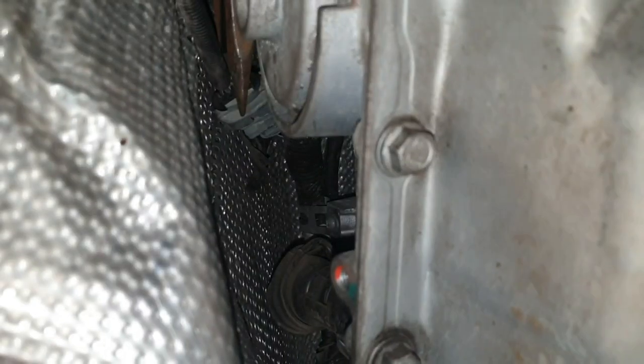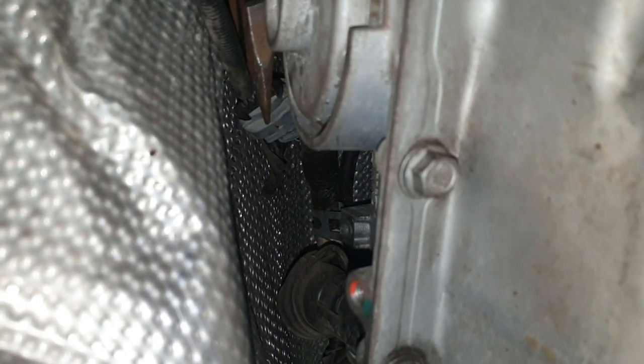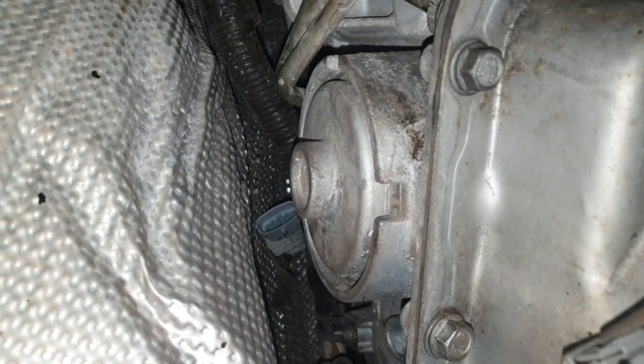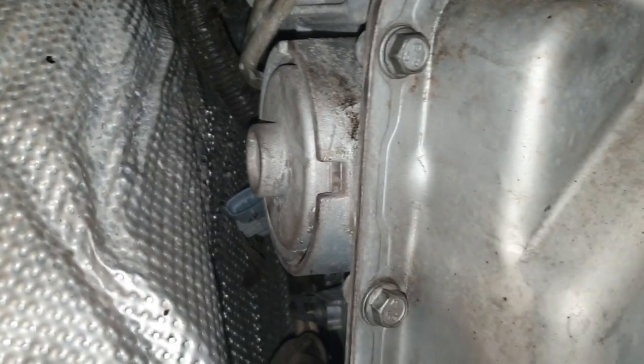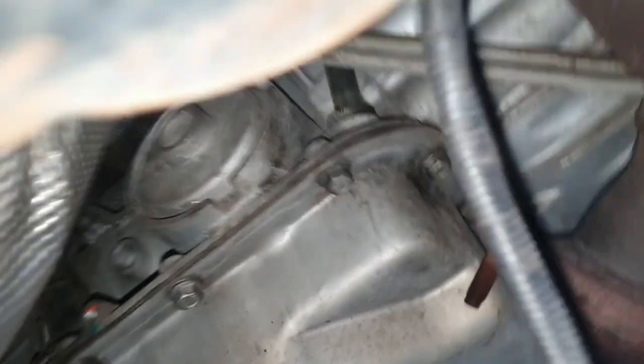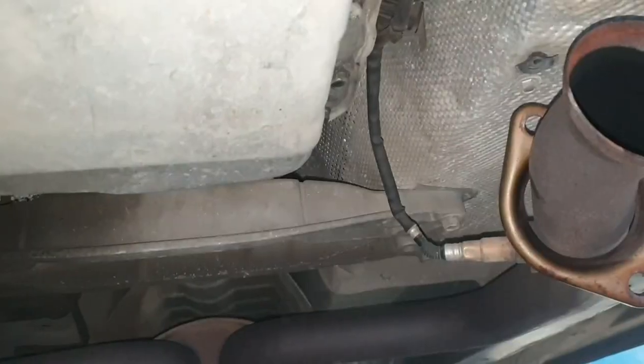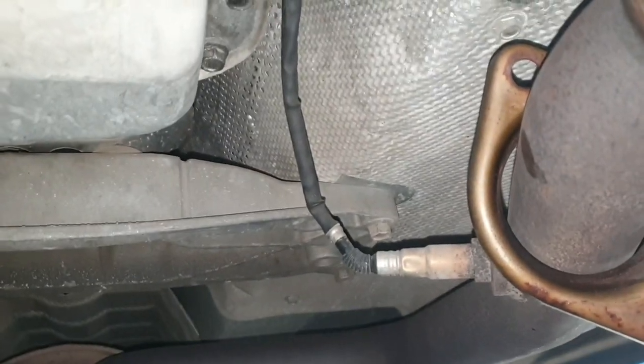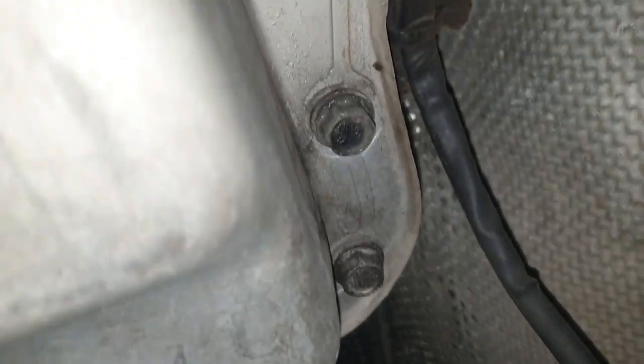With some long-nose pointy pliers I was able to free it off by pushing down that tab. The right-hand side catalytic converter is now removed. Now for the pre-cat oxygen sensors — these are the after-cat, post sensors. Just disconnect those; looks like someone has cable-tied them again. These are pretty simple, and that's so we can get the exhaust off next, which just makes it easier to get to the drive shaft.